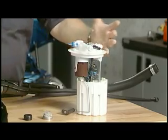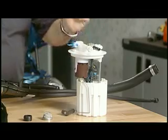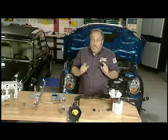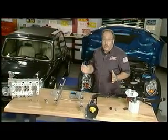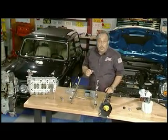But it gets worse. The fuel pump, this capsule assembly, the fuel gauge — all of these things inside the tank are different, so you have to change that. Even the tank itself, if it happens to be steel and a product called Terne metal, you're going to have problems if you use E85.